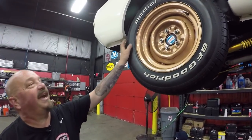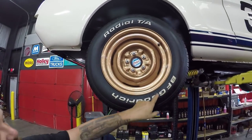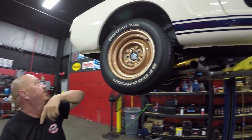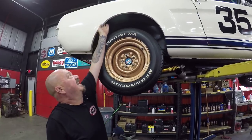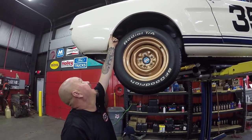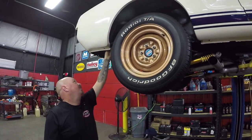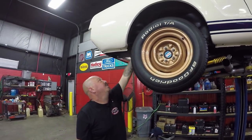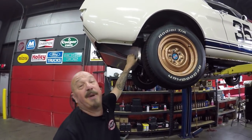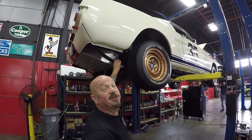All right, out back here, look at there, Currie axles. We've got 215, 65, 15s back here also. Great looking rims again. Again, this edge right here, that's just two pieces of metal, that inner wheelhouse and that outer quarter panel all welded together. Pinch weld here looks good. Frame looks brand new. That's the mounting bracket there for that cool sway bar. I tell you, everything about this car is amazing, guys. Now let's get under the hood and see what's making the power.